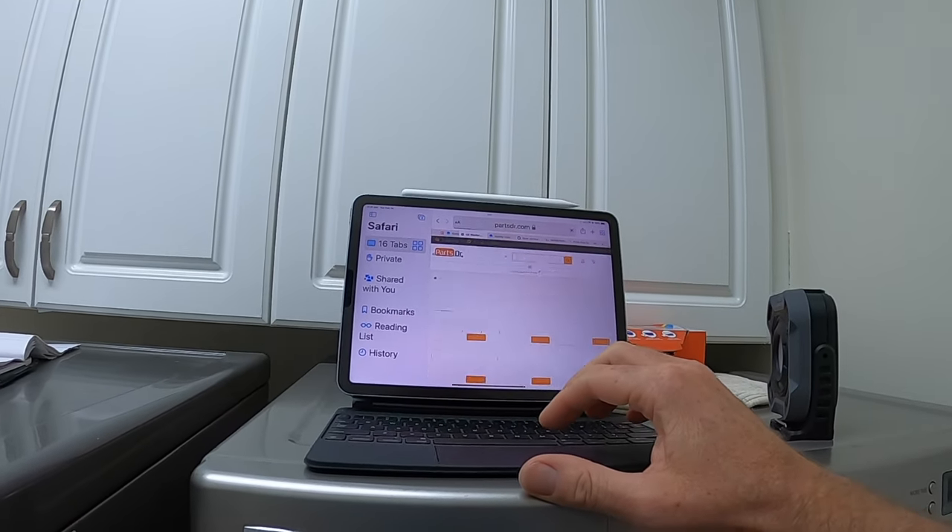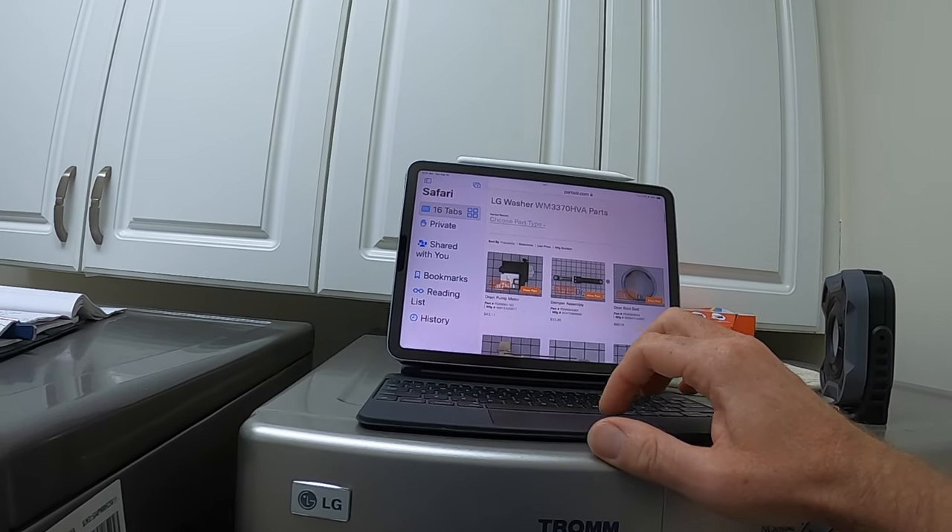I'm looking up the model number and checking on suspension rods to give the customer an estimate. The shock absorbers are $33.85. The diagnosis is that the LG front load washer needs new shock absorbers and new suspension. We ran it through the tests and it went into high-speed spin just fine with no load. Then we put four towels in on a speed wash — the last six minutes it drained and tried to go into high-speed spin but couldn't, just moving back and forth doing light tumbles trying to balance the load. The machine is sensing the load is off-balance and too wobbly, so the assessment is it needs new shock absorbers.